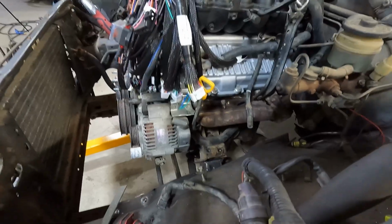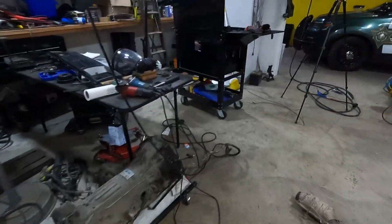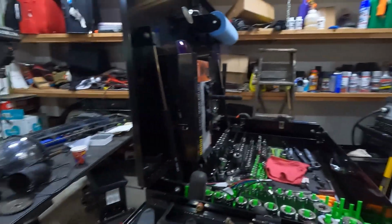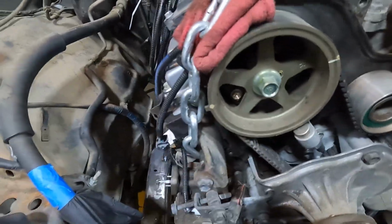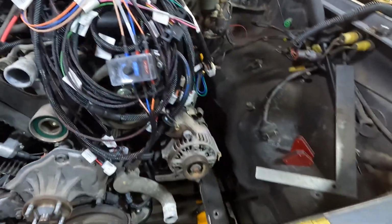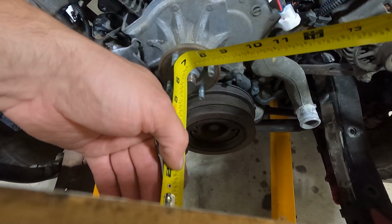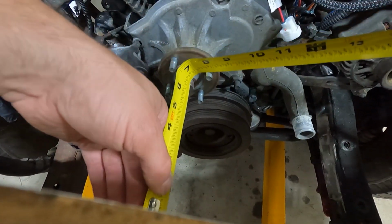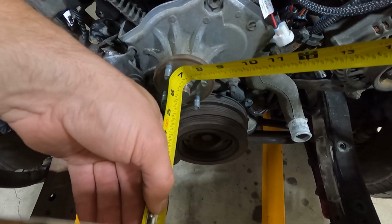I think I'm gonna go ahead and just finish weld these in there. I do want to measure on this real fast. Let's measure this and see if we picked up a full inch, because it almost seems like it's still a little tight. Tape measure in here and see. Right at 6 1/4, and this is about a 3/8, maybe 1/4 inch piece of material here. So should be right at about 6 1/2, said and done.